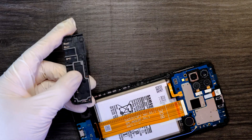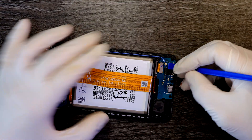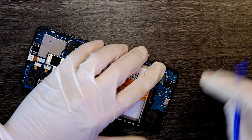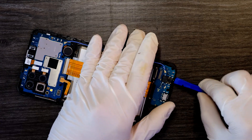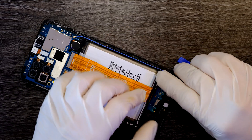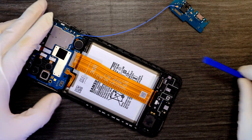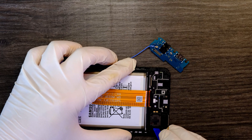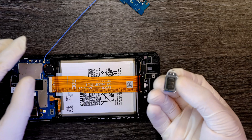Okay, it just comes off — that was easy. Now let's disconnect all the cables we see here. There's adhesive tape running under the small logic board, so be careful when prying up. Don't apply too much pressure or you'll break the little logic board. There's also a speaker unit right here that we need to remove — pry it up nicely.